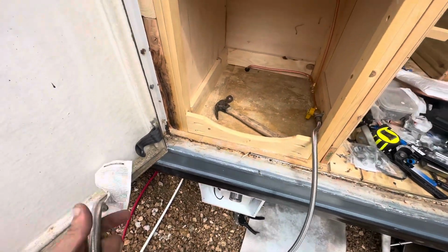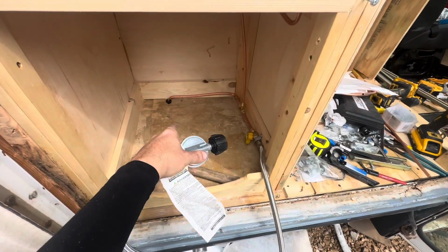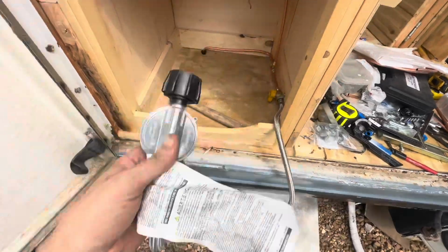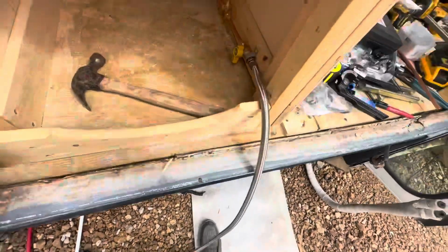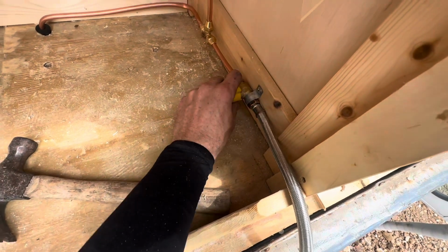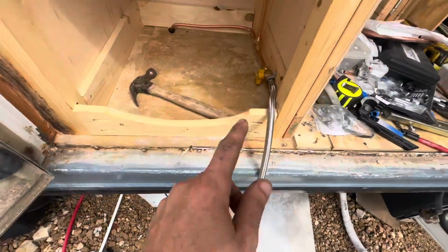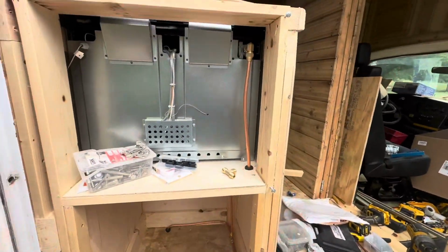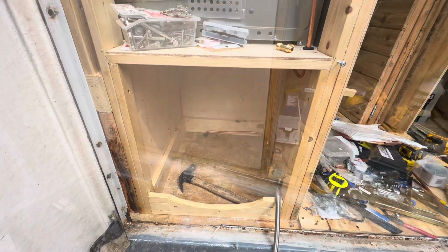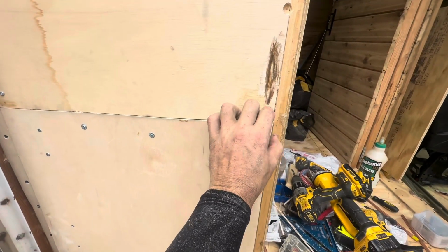I got a 5-foot long hose, so that when a tank is in here, and I have a metal stand that anchors to the subframe, and this is plugged in, when you unstrap the tank, you can sit it down on the ground. It then comes from a cutoff valve, which is rather redundant, but I still put it in. And then we have a simple T, and one goes down directly to the water heater, another one goes up directly to the stove. Simple and safe, y'all. The goal in this whole thing is to help seal the propane into this pedestal, basically.